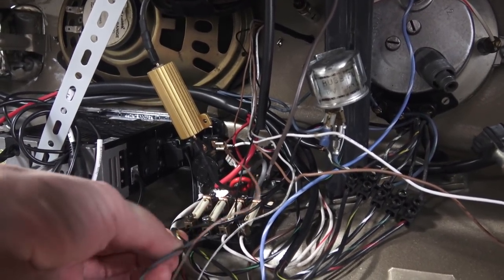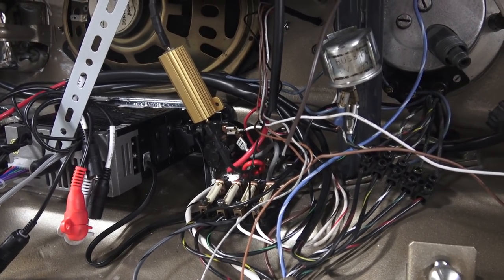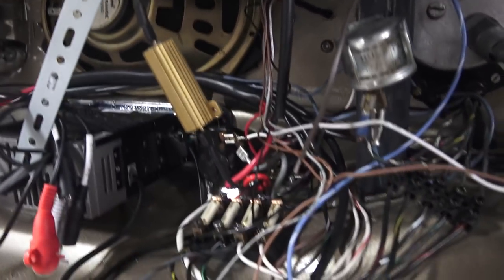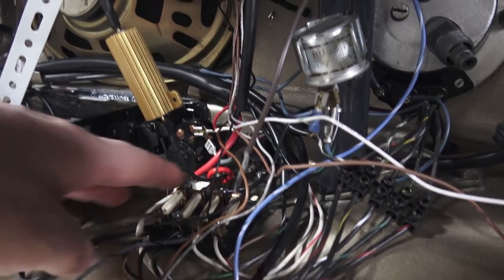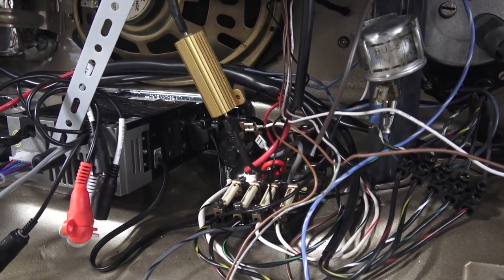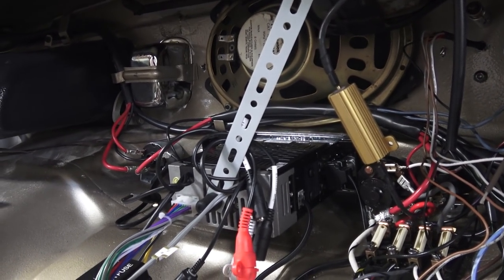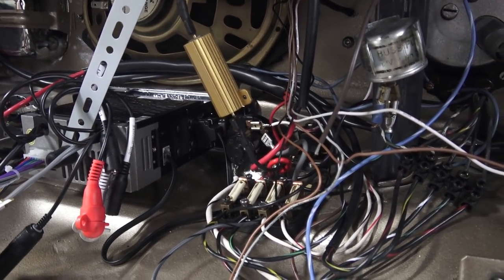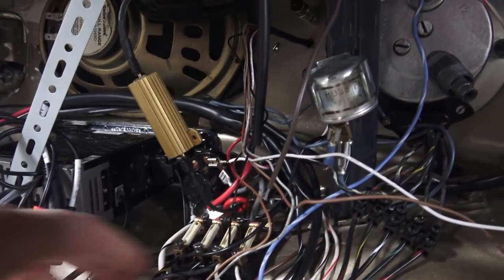You want to print out your bug schematics so you understand what wires go where. There's a new wiring harness here, and they usually give you a schematic with it. I just start unplugging the fuses. For the most part, it's usually not the tail light area — it's usually areas like the wiper motors, your hot lines that go to your starter, battery, or regulator. The radio is also very common to have a draw, because sometimes the power to your radio is on a constant terminal. You want to make sure it shuts off with the key off.